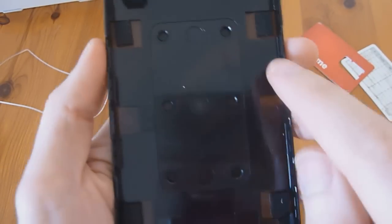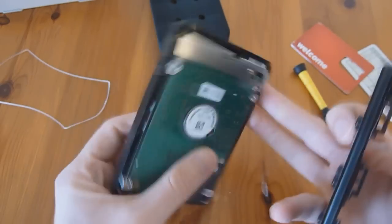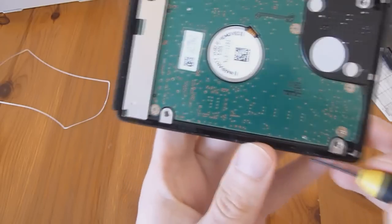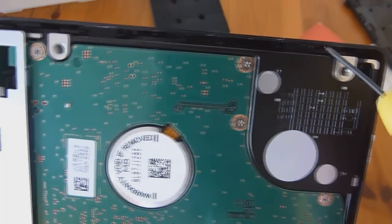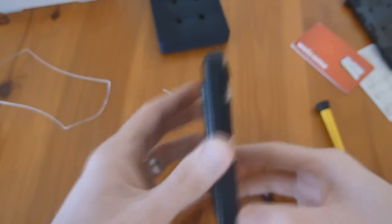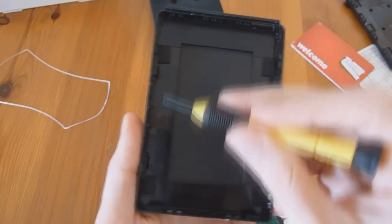There are a few rubber pads here that act as shock absorbers, and right there as well, which helps absorb any shock around the connection. There are more shock absorbing pads basically around where the screw holes are for the hard drive — two there and two there. To remove the drive, pull it from the back first because it is obstructed by the plug connection. Pull from the back, get it loose, then pull it out from the chassis. You can see the four different rubber pads there.